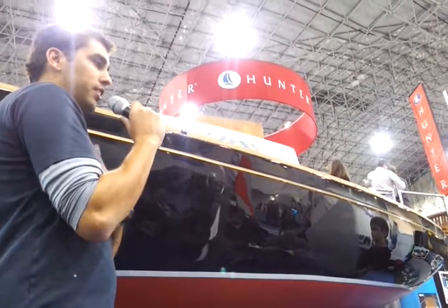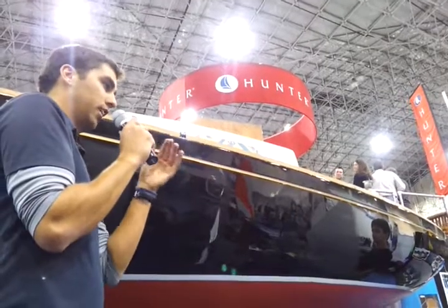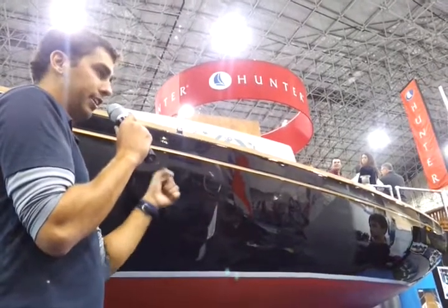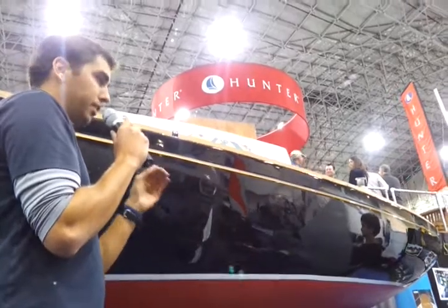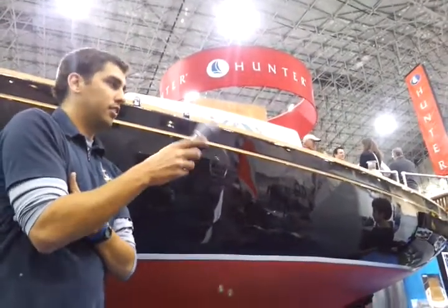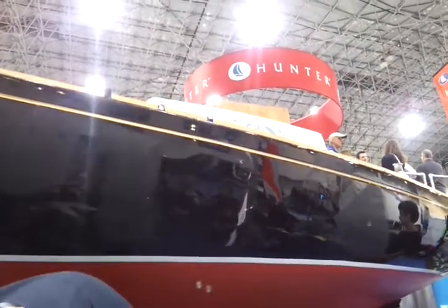Instead of buffing out the wheel, if you have some steps or some non-skid that's getting faded, chalky white, just get some soft scrub and a stiff plastic brush and just go at it. That's going to be very gritty. That's going to knock off a lot of that crap, and it's going to give you a much cleaner surface. Yep, just the soft scrub paste.